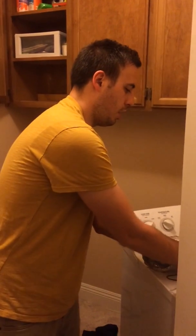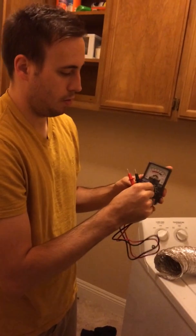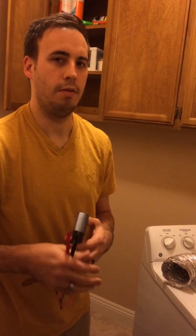But that's it — it's pretty simple. You can use the same logic in testing any AC wall outlet. In that case you would want to keep it at 250, but that should read at 120-125 volts for a typical AC wall outlet.